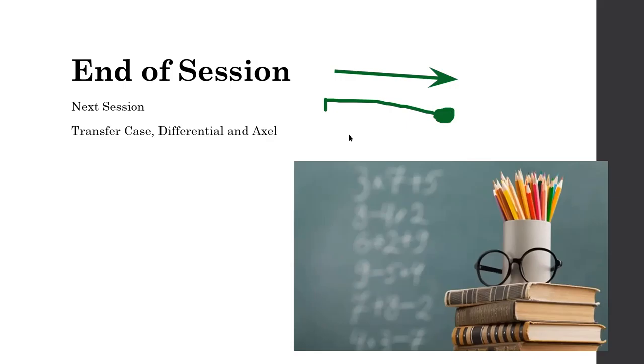Can somebody tell me how does a diesel engine control its speed? Diesel engines come with an inherent problem. Let's say you press your accelerator pedal halfway. The engine's highest RPM is, say, 3,000, so pressing halfway means the engine should go up to around 1,500 and stay there. In a diesel engine, it's never going to work like that, because of their high energy density and the high torque they generate all the time. If you do not govern it, it will start to increase the vehicle's speed. So diesel engines actually have a governor.